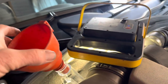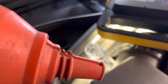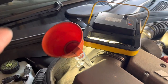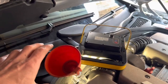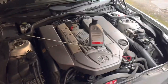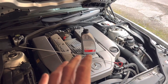Make sure that when you use a funnel you either put a paper clip or something in there for an air vent, or use a vented funnel — that groove on the funnel is the vent. Otherwise you'll pour transmission fluid in, get a massive air bubble coming up, end up with transmission fluid all over the car, or worse still get an airlock and nothing will happen. When you come to top up or refill after changing the transmission pan gasket, you need to know how much oil to put in.